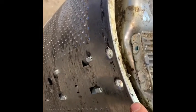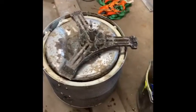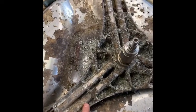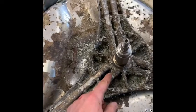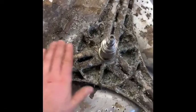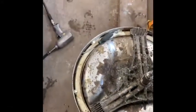When I unbolted the spider from the bin, some of the bolts actually broke. If you're ever using a used spider, you've got to be careful about that. What I'll do is drill them out and re-tap them — I might go with a bigger bolt. That's what I had to do on the last one I fixed, which was another brand. It had broken around the arms, and I ended up using pieces of aluminum into the grooves — long grooves — and did the same on all three legs.